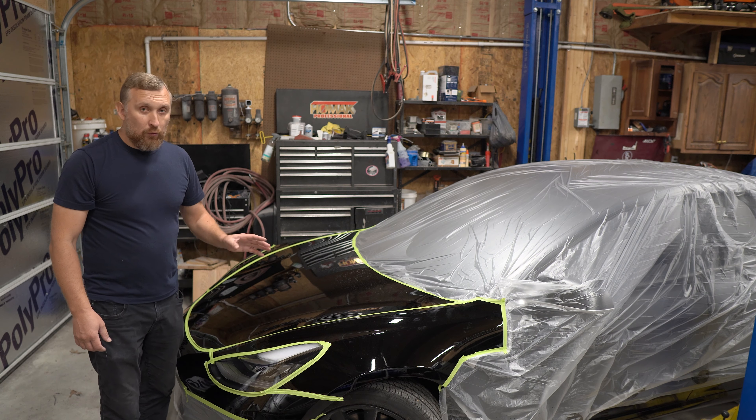Right now you won't see much, but there are some scratches in this area, and to get rid of those I would have to hit it with 2000 grit because I think these are 1000 grit scratches. Overall, if you stand at a normal distance the car looks great. It's all up to you and whatever is acceptable for you. For me, this car is gonna have probably tons of scratches a lot bigger than what I just showed you after about two weeks of driving.